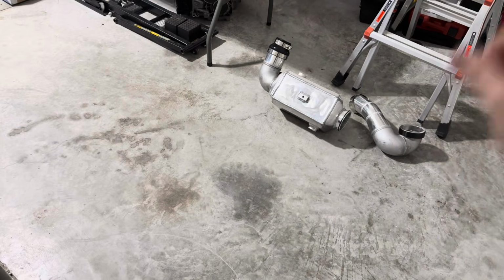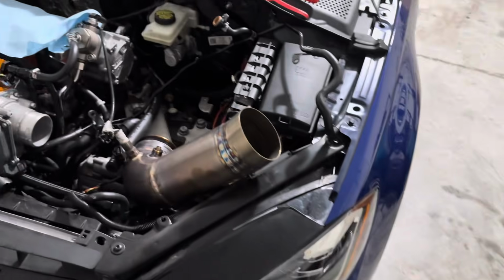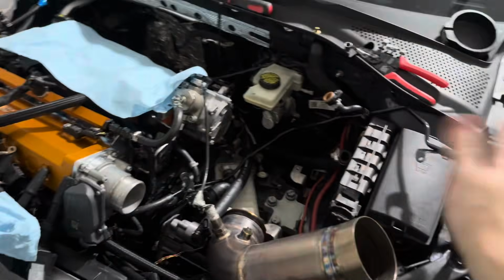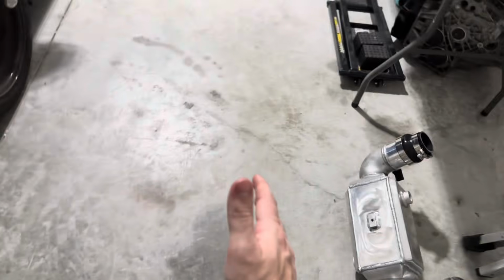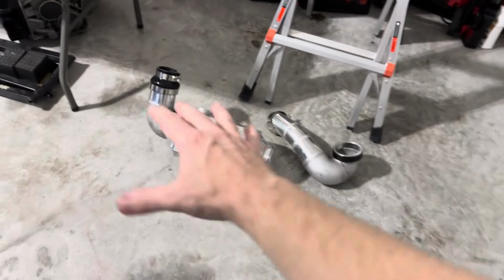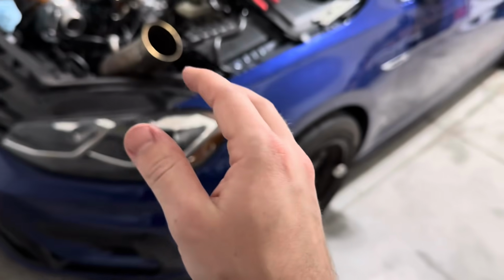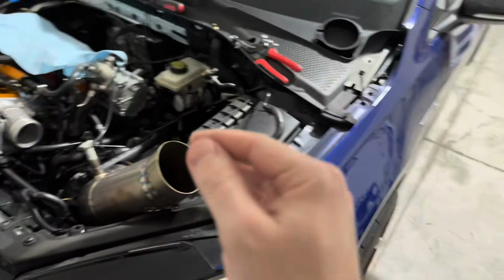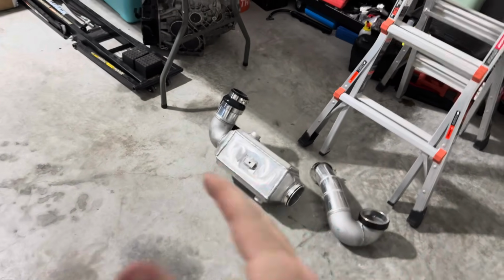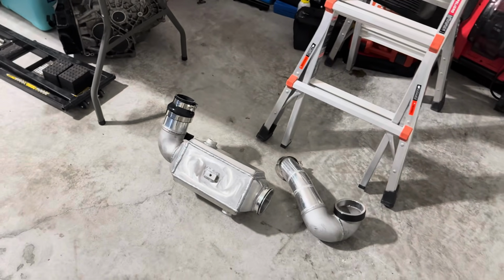Everything else regarding the air-to-water system, just the shorter piping and everything, has made it incredibly easy to work on this car, with not having a bunch of stuff in the front. Switching to dry ice and a coolant, so that way I can really lower the fluid temperature that goes through the core. The main point of switching to something like that is the rise over run will be right around between 0 and 20 degrees at start, and then 60 to 80 degrees at the end, assuming I don't switch the fittings. If I do switch the fittings, it'll probably be 0 to 20 up to 40, maybe 50 degrees range, which is stupid.